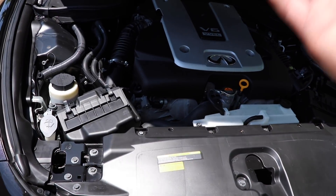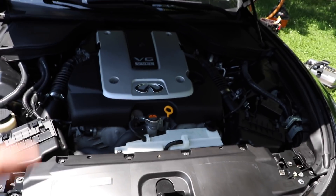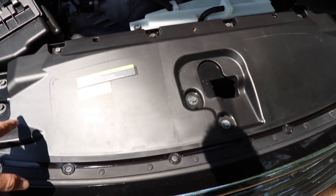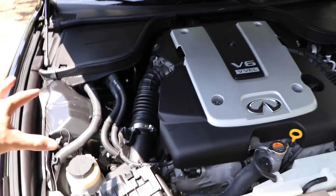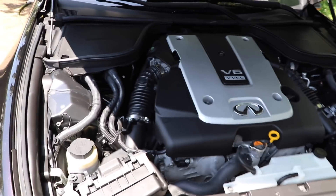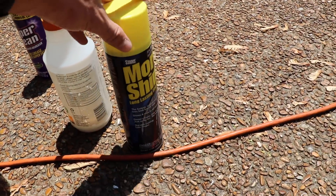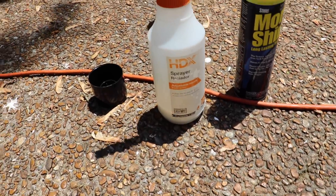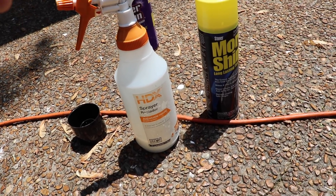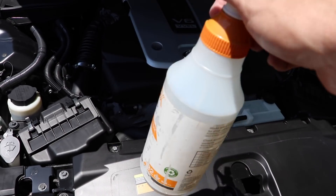The engine has been run for about 10 to 11 minutes, so everything on the interior is dry. You guys can see it looks really fantastic — look at all the black trim, the metal pieces in the engine bay. Everything has been totally degreased, even in these creases. The next step is to dress the engine, shine the black trim, make it pop, and more importantly protect it so the next time I go to clean it it's much easier. I use two products to dress engines: More Shine Tire Shine by Stoner, and Chemical Guys VRP diluted 5 to 1, which is what I'm using today. It's a water-based, water-soluble tire and interior dressing — I dilute it 5 to 1 for wheel wells and engine dressing.